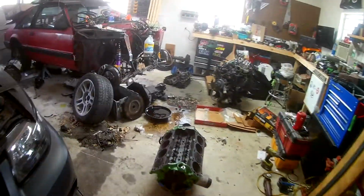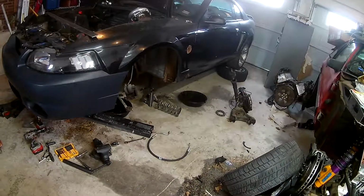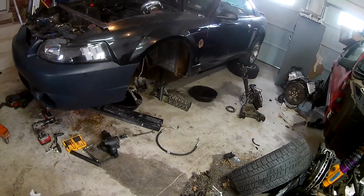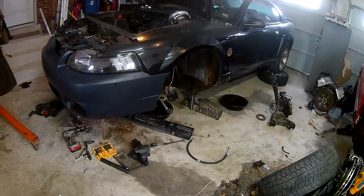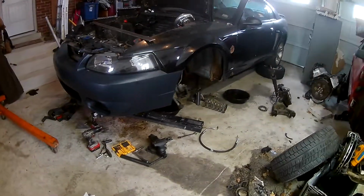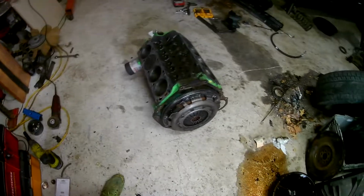And ended up just cutting the springs a little bit to get it a little bit lower and remove it from four-wheel drive status. It may eventually get a set of springs, probably not, but we'll see where it sits after that, and we'll probably have to cut a coil off the rears just to drop it down. But for now, we're going to get this all put together.